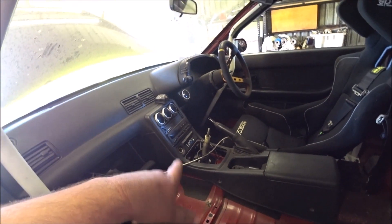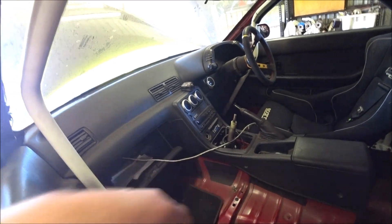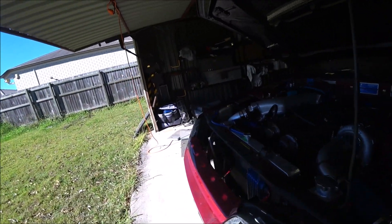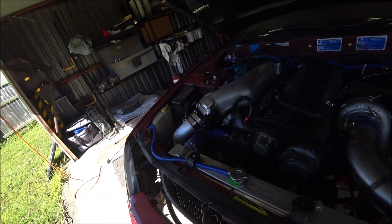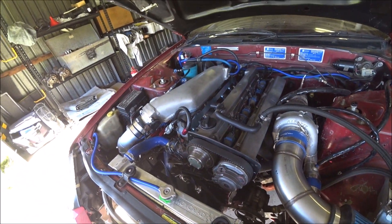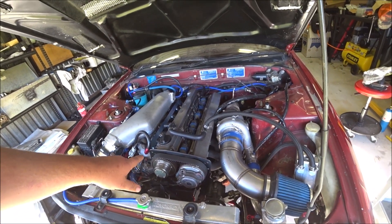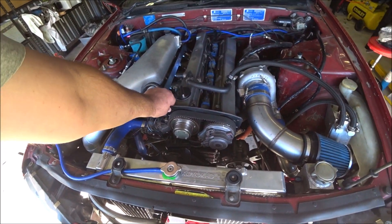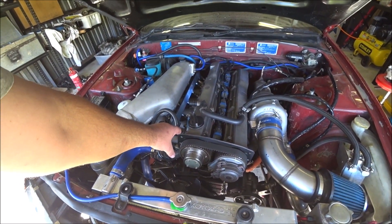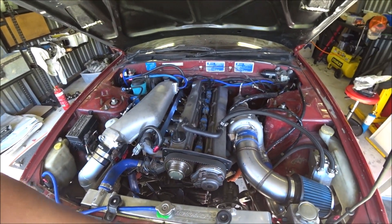A few other bits and pieces — putting the boot and everything on the gear knob and fixing all that up, mounting the crap at the front properly like that oil cooler that's just hanging by a couple of bolts at the top, and obviously re-tensioning the timing belt a little bit tighter — not a lot, just a little bit. Also I need to procure the bolts for the timing cover. I might leave it off to take it to the tuner though, because he's going to take it off anyway to adjust the timing.